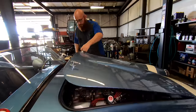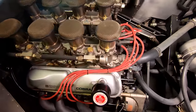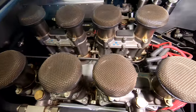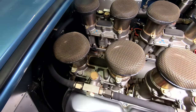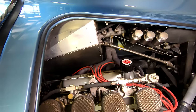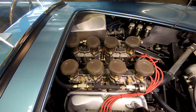Let's go ahead and open the hood. Here we see not a 427 — this is a 289 Roadster. It also does not have a four-barrel carburetor; it has Weber two-barrels. These are very cool carburetors with very good throttle response, and they make it sound really good as well. The engine itself is a little smaller, and you can just work around it — there's so much more room in here. For a guy who wanted to own one of these and work on it himself, this would be the ticket. I would want the 289, not the 427.